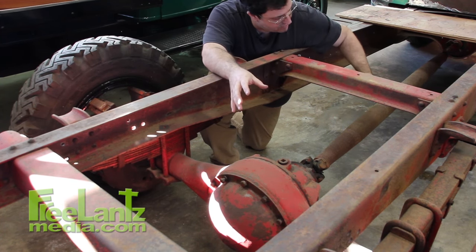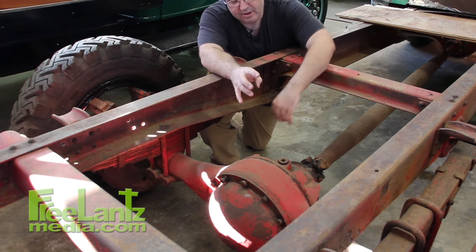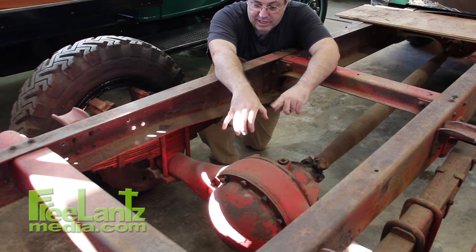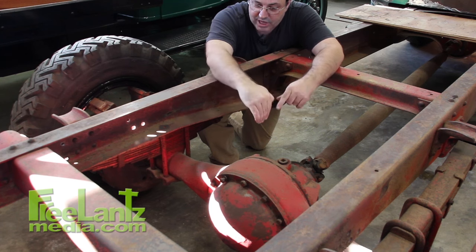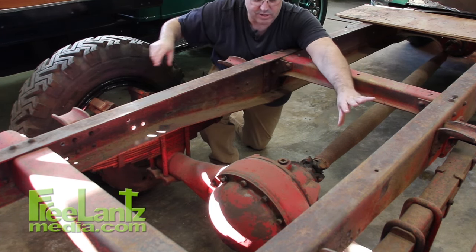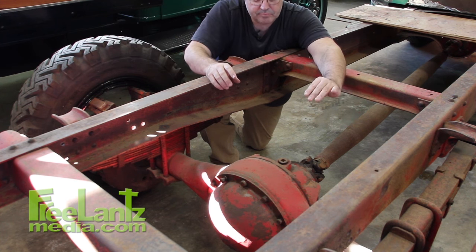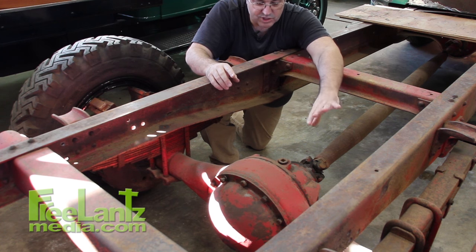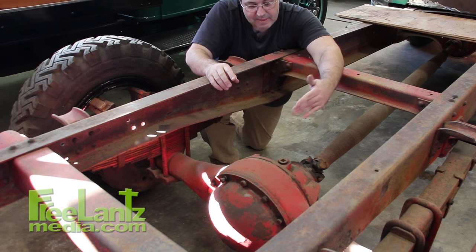This is a 1936 International truck — it's pretty conventional, and this is pretty much what's going on in most of today's trucks. You've got a driveline spinning a pinion gear, the ring gear is rotating, and that sends the power directly out to the wheels. The ratios in this thing are probably four to one.